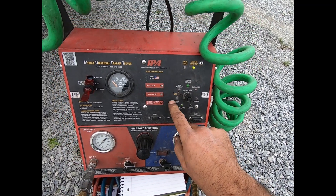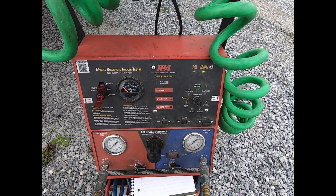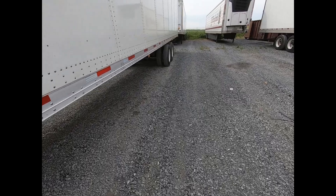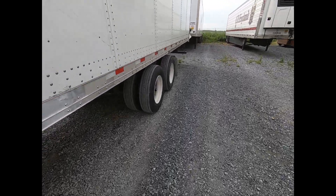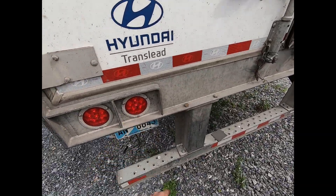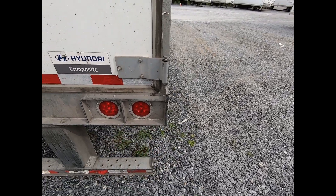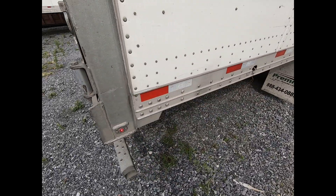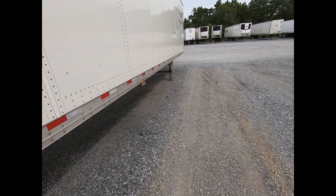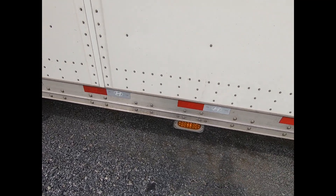With tail/tag on, there's no overload — which means that light or the wiring leading to it is bad. All other marker lights should be on: we have a dimly lit left mid-turn, both tail lights dimly lit, the license plate light on, the clearance light, two dimly lit marker lights on the other side, and the right mid-turn with marker light. This marker light is not on. We can be confident that light is bad — we'll replace it and that should take care of the problem.